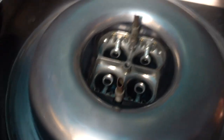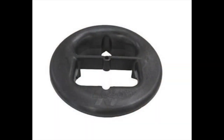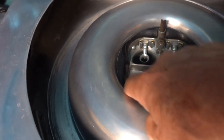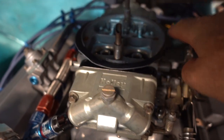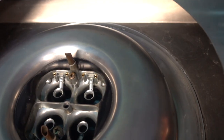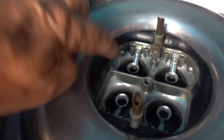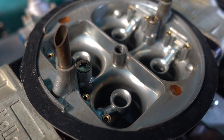The center piece here is actually an old K&N stub stack that you can see around the edges here, that just tapers the transition really nicely into the carburetor instead of going down and just hitting that big flat surface. You can see the way that comes down and how that makes such a nice transition into the rest of the carburetor — it just takes air coming over here and goes shoo. I like the divider between the primaries and the secondaries because it keeps the velocity up when you're only on the primaries.